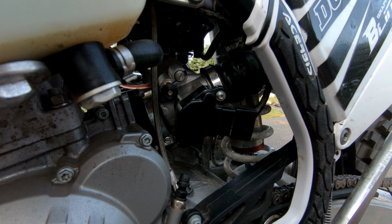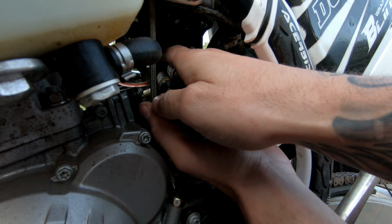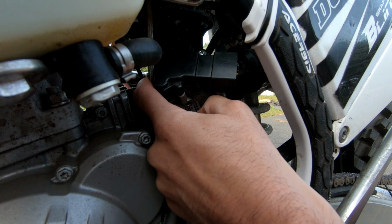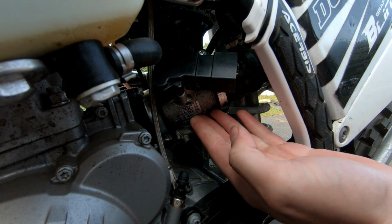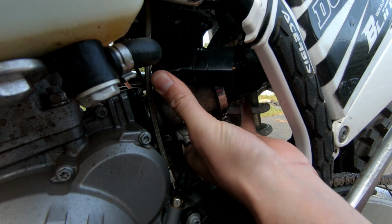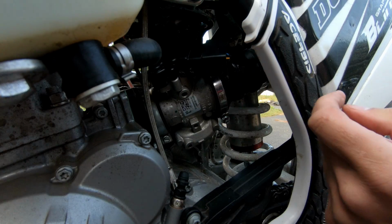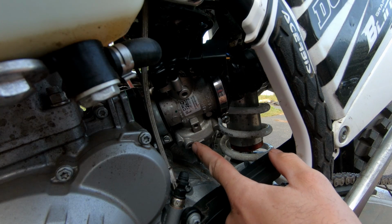All right. Once you know you got that soldering iron on there for a while, and you think the grub screw is nice and hot, you're gonna now push this way, and there's a little keyhole in here that locks the throttle body into the boot. Try to pull the throttle body back this way. It slides underneath the boot anyways, but just be mindful of that. And you can slide this all the way up until your choke pull hits this little relay up here, and here is the hole that you're working with.